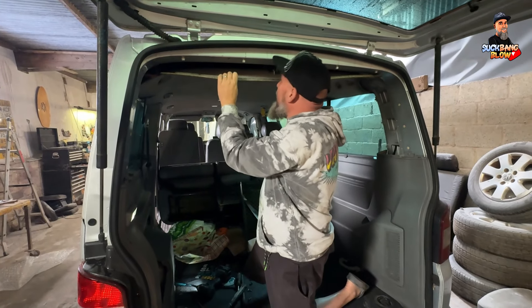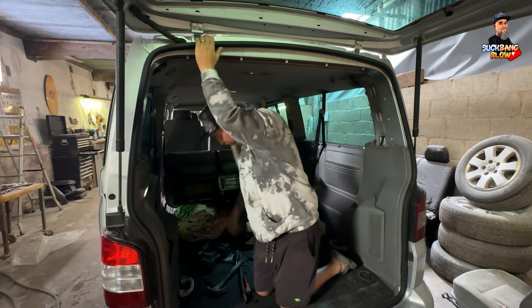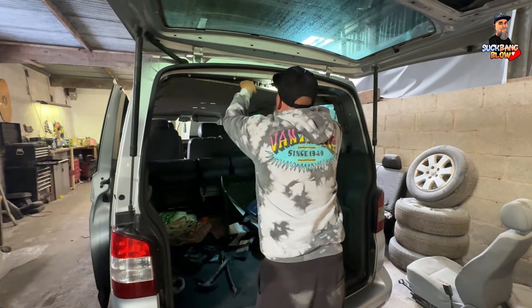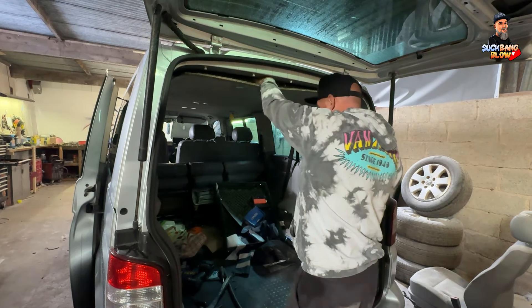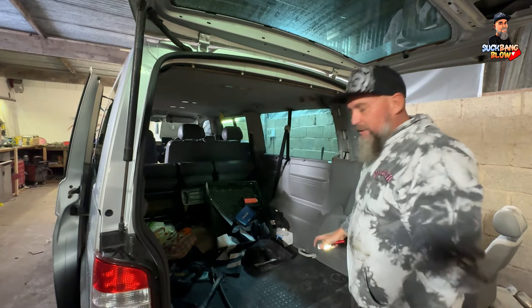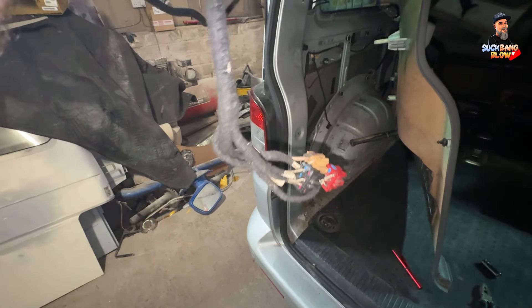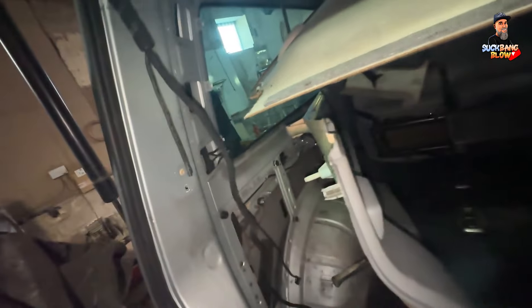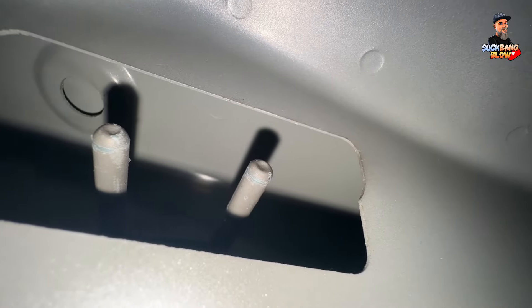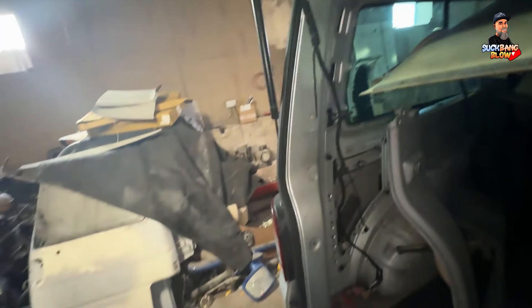Pull it down enough to be able to get inside. There's a trim clip there that I need to get out — that will then pop. I've managed to unpick the wiring, which now looks like I'm going to have to change, because I've got three plugs in this and the other boot's only got two. They come through there and they're a pain up the side there, but they're out. Those two bolts there are the same ones that go through the hinge, so let's undo those two — same on the other side — and the stays, and then it should in theory lift off.